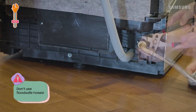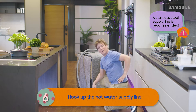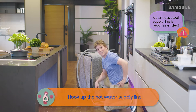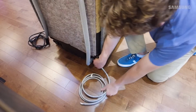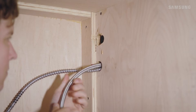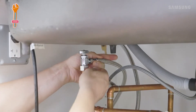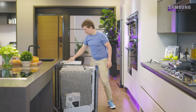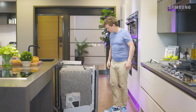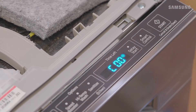Now we have to hook up the hot water supply line — it'll take some maneuvering. Line up the dishwasher with the cabinet and power cable and secure it. Pull the drain hose through the hole in the sink cabinet sidewall, then connect the hot water supply line to the fitting joint. Always use the correct parts and follow these steps closely, or an LC or LE water leak error will display on some models, which will temporarily keep your dishwasher from working.